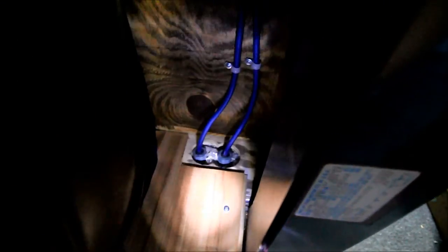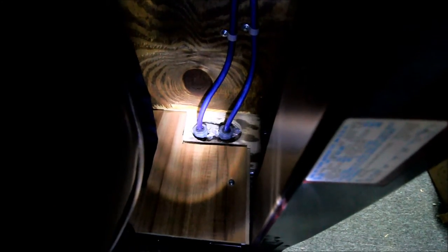So I showed you underneath how the wires go right up through the floor, coming back right here by my driver's seat. Looking down there, you can see those cord grips. One is hot — coming from the battery — and one is coming from the frame for the ground. Since the battery is grounded to the frame, that's the best place for it. So I've got one hot and one ground. They come up into the cabinet through holes I drilled.